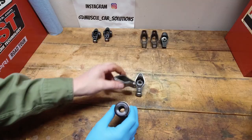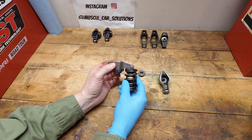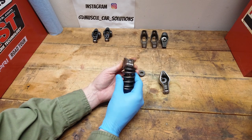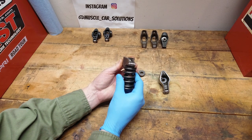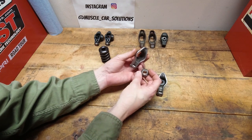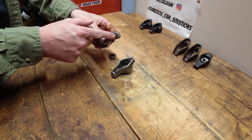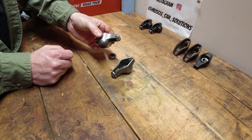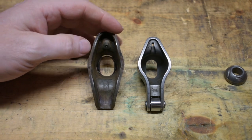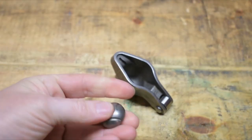There are some cons to this design. Sometimes people have a little trouble with getting a little too low on the stud, and because the bottom isn't really radiused very well, you can get into some issues with retainers. But when you're at 550 on the max lift, you really shouldn't run into those problems. Push rod length is really critical on any roller tip rocker arm — you have to make sure you have the right pattern on the valve stem and the correct length push rod. Use a push rod length checker to make sure you've got the right contact place on the valve stem.